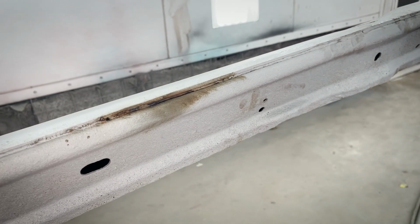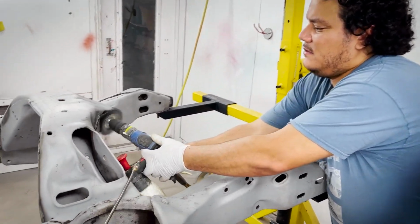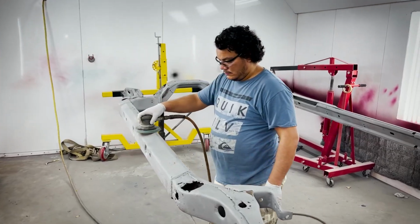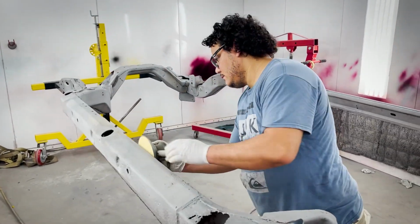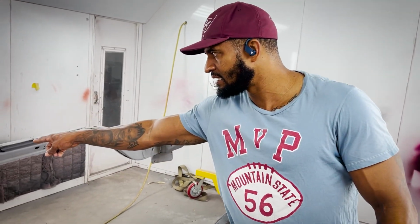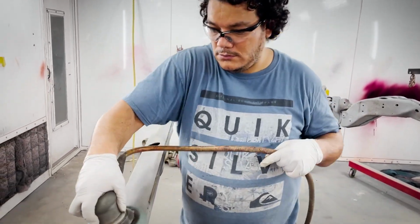of stuff like this. So the painstaking process now is for Red to go over the whole frame, double check, make sure all of the gooey situations are out so we have good paint here when we're priming, because we're basically putting both frames in etching primer to avoid this. Once we sand all that down and put it in etching primer, now we can handle it. Now we can touch it, and you don't have to worry about the rust spots coming on.